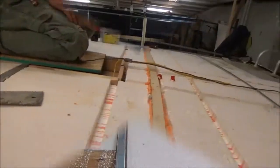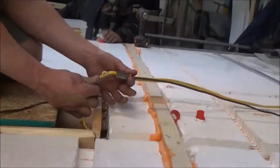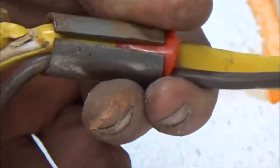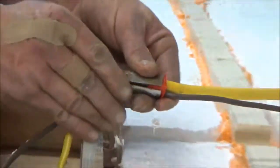We're back here, this Condor. We've got these pieces fit in here, these new trusses we made. One of the things we came across, see there's a ferrule right there, that steel one. And you can see the wire has been just getting chewed up. You're supposed to have those little red inserts on there so it protects it from the ferrule, but no one ever puts them in. So that's what we're doing now, get those in.